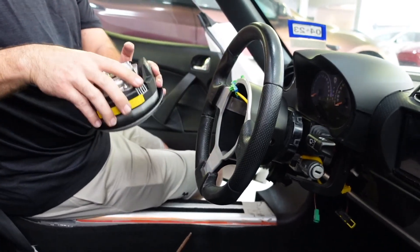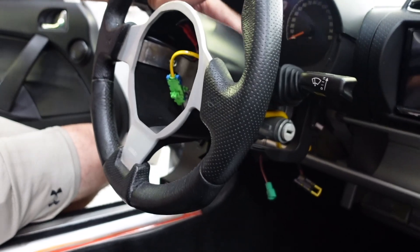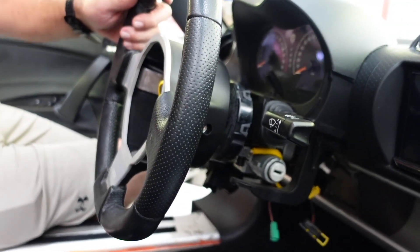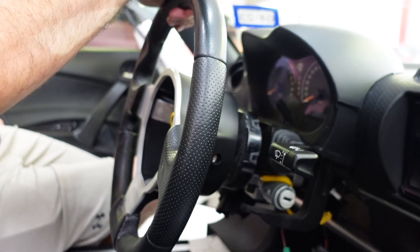Leaning back because I'm scared at this point. So let's set it someplace away from the car. Here's where you can do some damage — you want to tape the clock spring back here to the wheel. If you separate those and the clock spring moves around, it will get damaged. Those are hard to find, right? Yeah, like four or five hundred dollars — if you're lucky, if somebody has one.